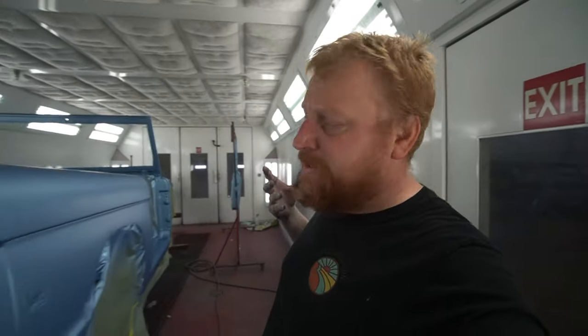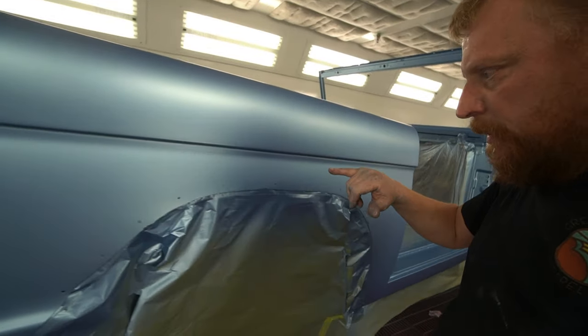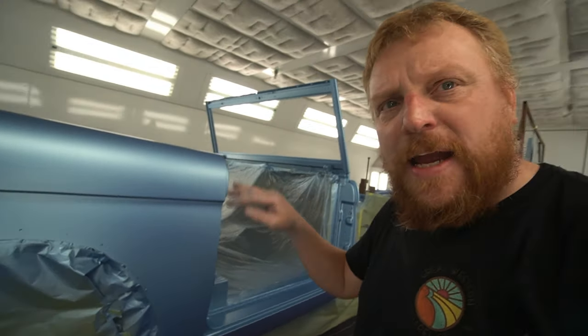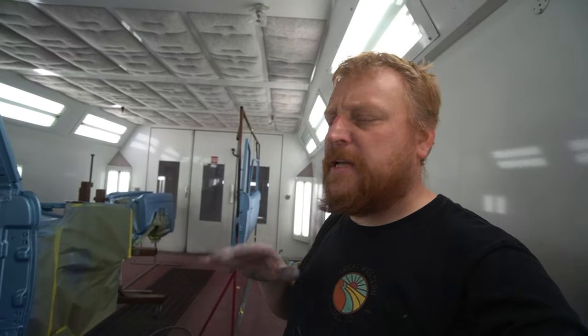All right, before we clear, we're gonna run in here and take a look at this, where we had wet sanded it down in little chunks. I believe it might have been in the sealer. Go all through here. It's looking pretty good. What I'm looking for is sand scratches. I did 800 and then 1,000. Part was 800, some was 1,000, so it shouldn't have any problems.